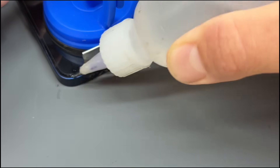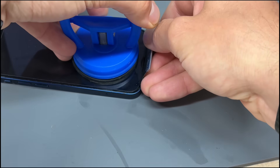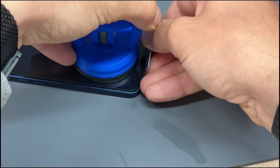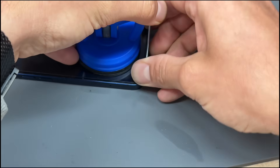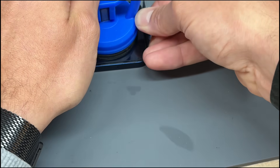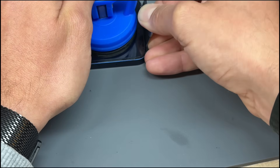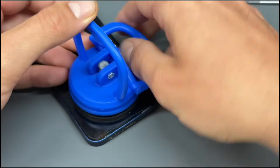I'm going to use a little bit of isopropyl alcohol — it's not squirting out very well. I'm going to lift up with the suction cup and then pry back with the razor blade. What we should find is that it will compromise the seal, popping the screen off. Sometimes it takes a bit more force than other times, especially on a cold day. I've snapped my razor blade — that's the first time I've ever done that. It's also a new type of razor blade I'm using, so that's interesting. This might ruin our chances of getting in that way.